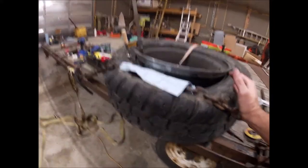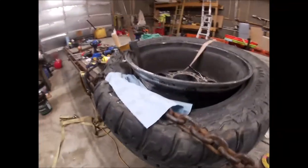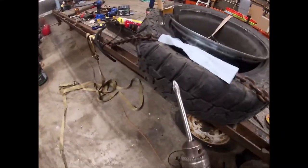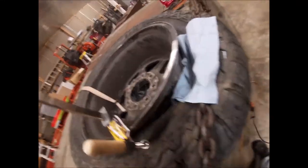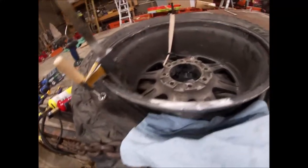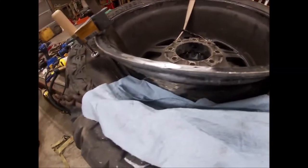if it wasn't for the tools I have, I would have just had this tire dismounted somewhere. But I've got cylinder head porting tools like this carbide rasp. I mean, this thing, I actually mowed through too much material right there and got a little bit of a divot. No big deal though. Main thing, I didn't want a high spot, because with a high spot the tire's gonna have a hard time to seal. So a low spot, and it's just a little bit low.